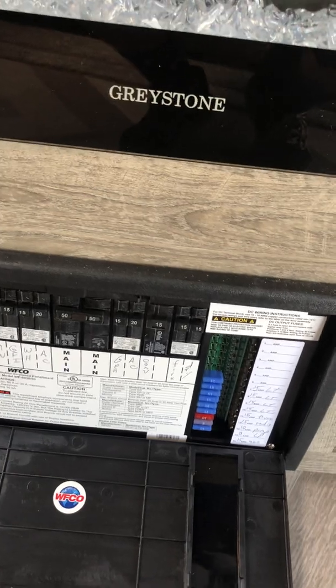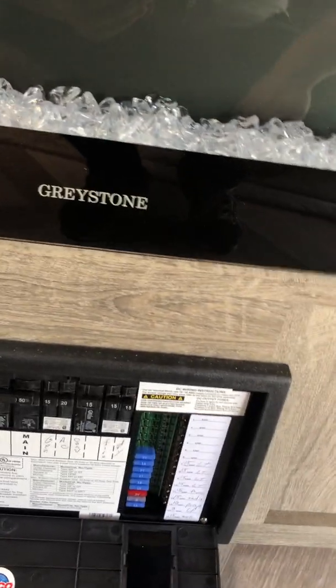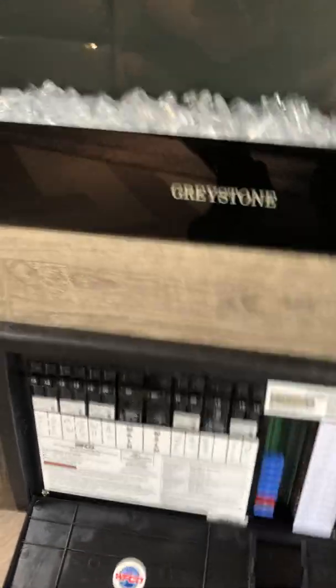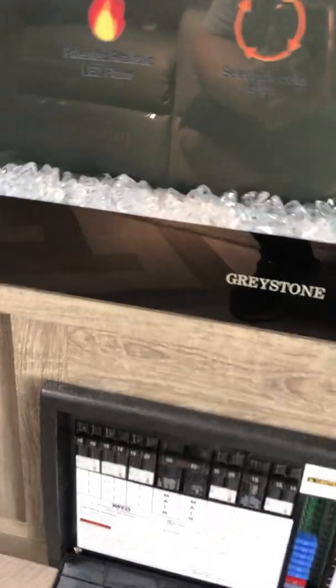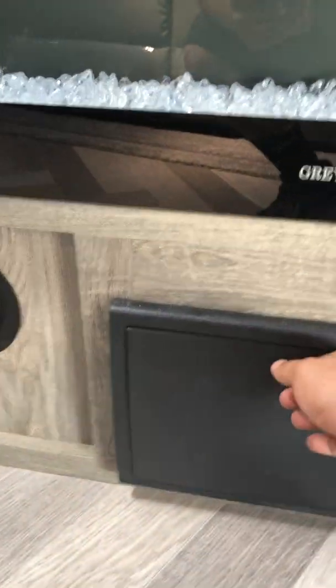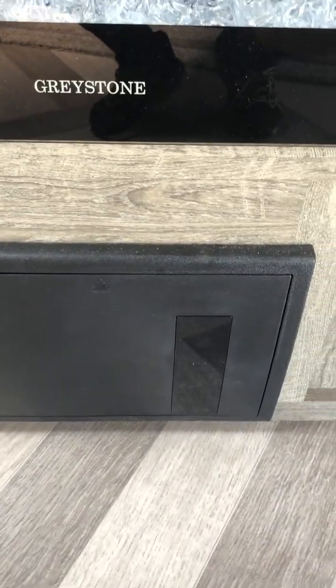You'll be able to charge your battery, run your fridge, get it nice and cold before your big trip. Just don't turn on the ACs because that requires at least a 30 amp outlet for one of them. If you try to run your ACs off a house outlet, it will burn up your cord.